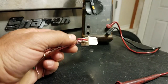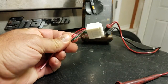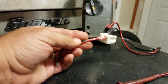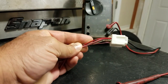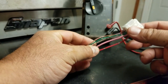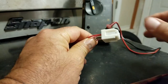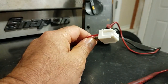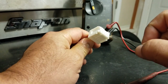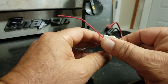Okay, Jay here. We're going to show you how we check for power on a connector — we're going to check for power and learn what back probing a wire means. This is an electrical connector from a car. You can see the wires going to the connector. There are a couple of ways you can test for power. One of them is unplugging it and seeing if you have power at the pins. Let's use this red wire right here as an example.